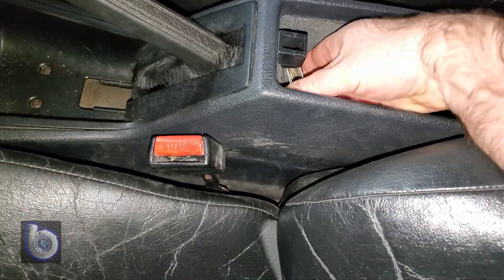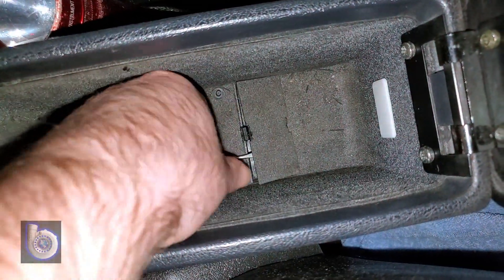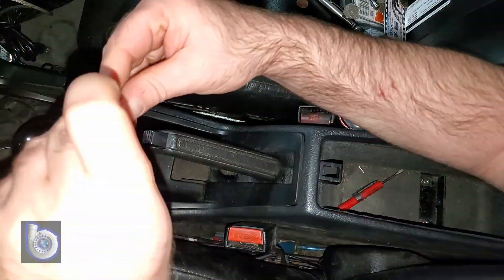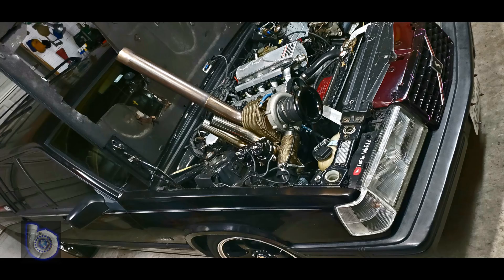Owners with automatics will usually have to change the torque converter to put this feature to good use, to allow the converter to slip at a higher RPM in order to come into boost. Using the e-brake for launch control is the answer for me. While staging at a light, I crank up the e-brake to set launch control. I have my foot on the clutch pedal pressed in, foot forward on the gas, car in first gear, and e-brake up. As the engine pops and bangs, it creates more boost.